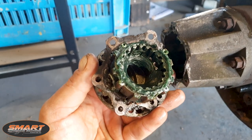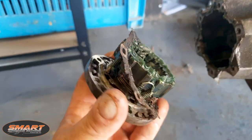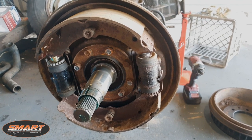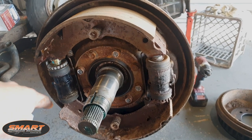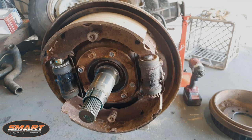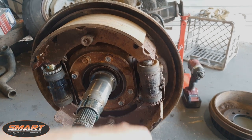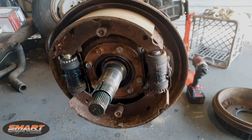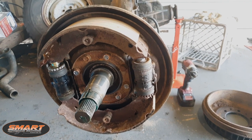It's fair to say these haven't been off for a while, but look at that grease - still retains its colour. Man, I love Land Cruisers. I know it might look rusty and old, but the condition of the grease and the colouration of it and if you look at these shiny bits here. Just before this was parked up and left for dust, it probably would have had a proper front end rebuild. I reckon it had bearings and wheel cylinders - maybe not the right hand one, but definitely the left hand one. And the shoes look like they've got loads of meat on. It's a bit of a shame - someone must have had a lot of work done on this and then just parked it up and forgot about it. Oh well, let's bring it back to life.